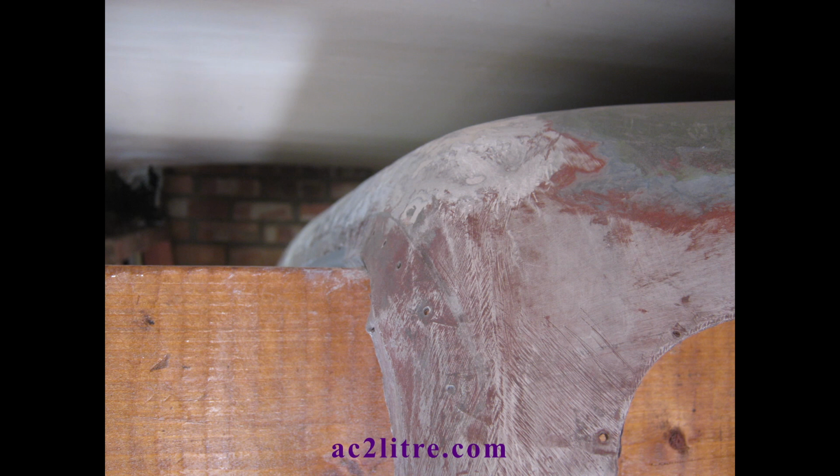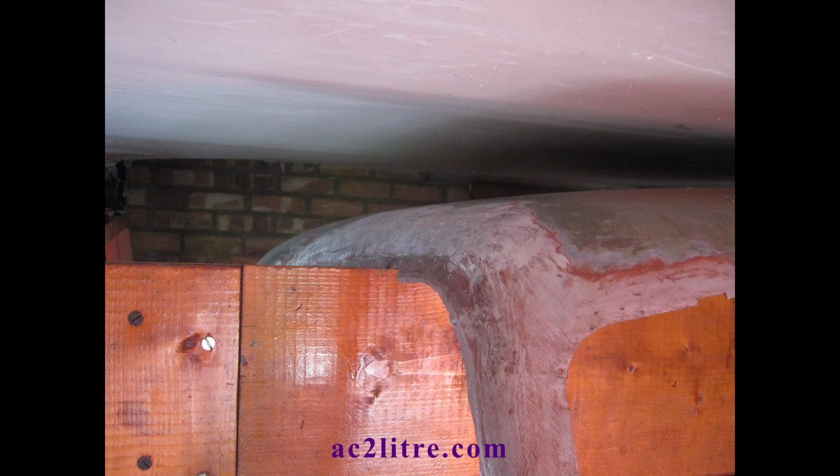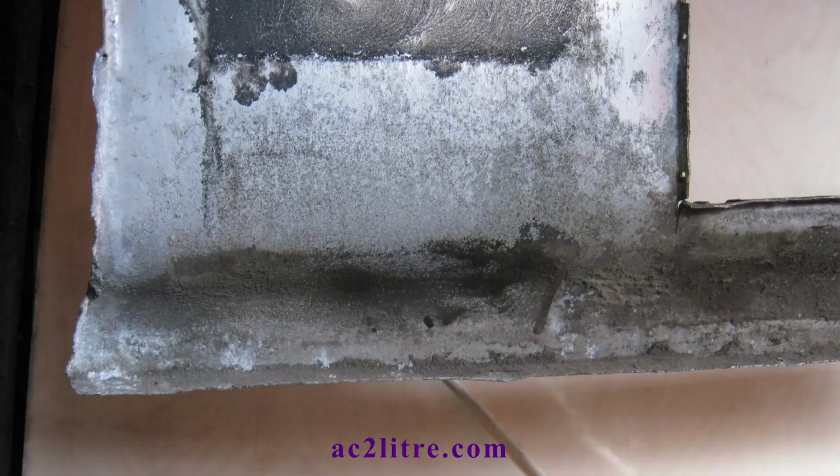As to the repairs, I've seen how professionals deal with aluminium panel beating with a range of dollies and hammers. It hardly seemed worth buying sets of tools for a one-off repair, so I used offcuts of plywood with various curves and hammered everything into shape. Unlike steel, aluminium doesn't spring back into shape. You have to work it as though you are almost starting from scratch.